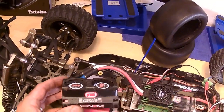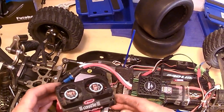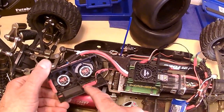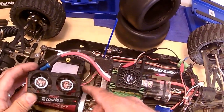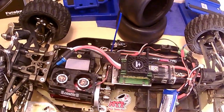This is the Castle fan for the fifth scale only — for the 20/28 Castle motor. It used to have two of these fans. I put two of them on and kind of rigged it a little bit, because I didn't want to have two wires coming out. So I made both fans run on one wire, and it worked.